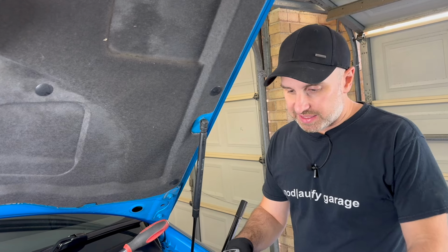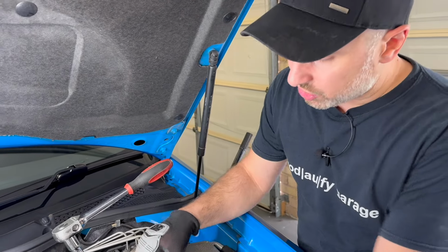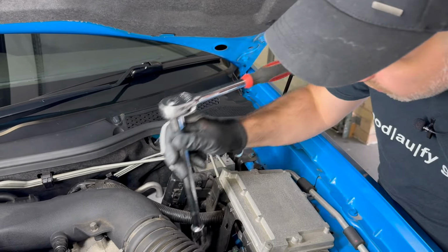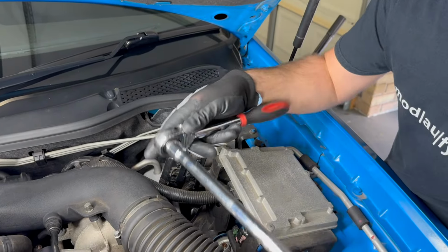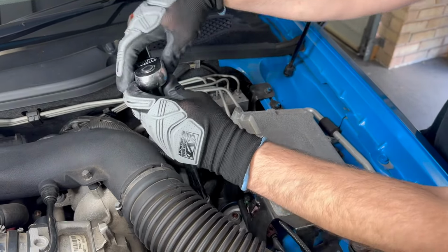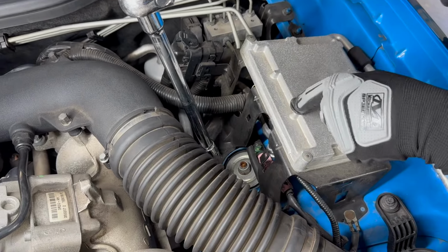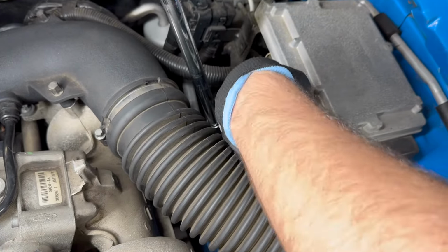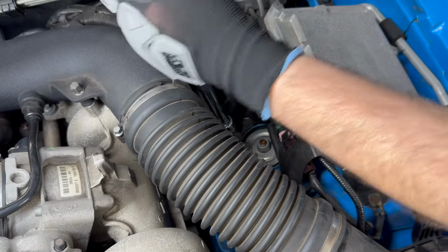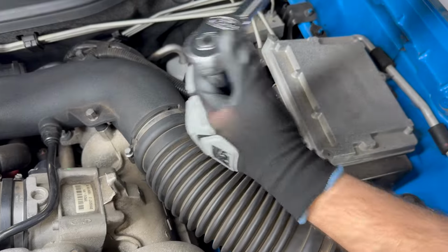Anyway, to get the suspension off, I'm going to start in the engine bay here. I'm going to try and not remove everything. There are 3 nuts that are 17mm. I'm going to start just loosening them up for now, so that you can find them. One is under the ECU, and then 2 are on the other side, but for the one under the ECU, there is a space to fit it through. So let me loosen these up.